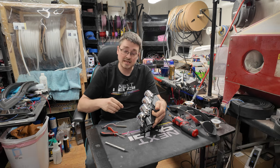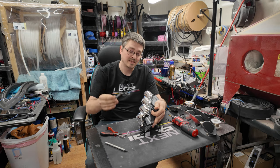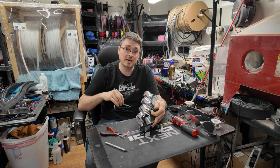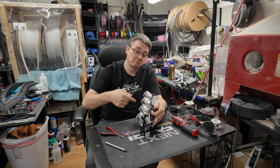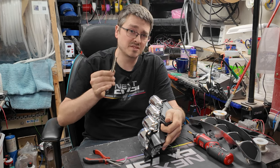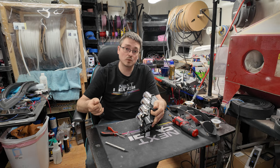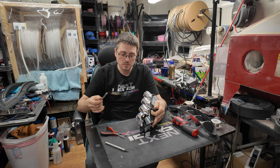But in the case of this, it's not hard to generally take something that's more of a universal product and make it into something that's cheap and effective. We do have demon eyes that would totally work in this application. You would just have to cut a little bit differently and aim that demon eye down in there, and it'll work fine. But this is cheaper. It's gonna have just as good of output because of the density of the number of LEDs that we're putting in there. And it's 12 volt, so I won't have to worry about adding an additional inverter in each light to run my demon eyes. So just something to think about.